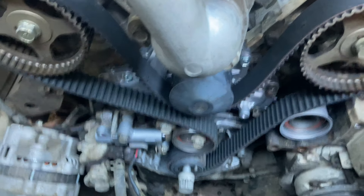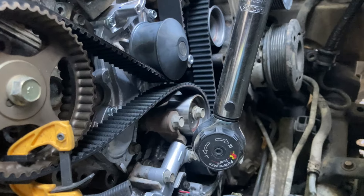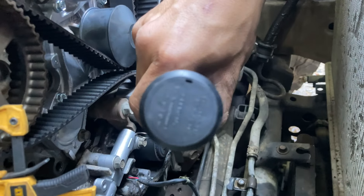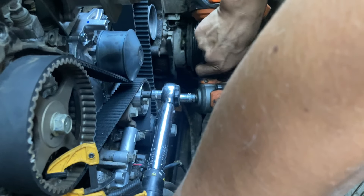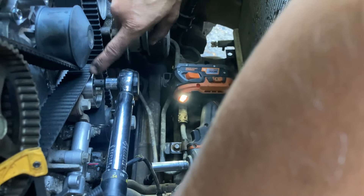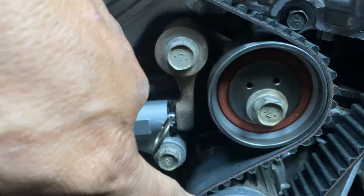This is the part that everyone screws up: setting the eccentric cam. There are two holes in the cam and two holes in this prong, and you're going to put it on an inch-pound torque wrench at 39 inch-pounds of preload. You line this tool up with the cam, get the two pins in the hole, and preload it against the timing belt until you feel a little click — that's as much pressure as you want. Then get in there with an impact or wrench and tighten it up. This is a really important step — if you don't do this you will wear out your timing belt tensioner prematurely.